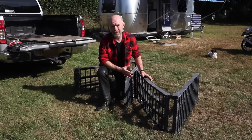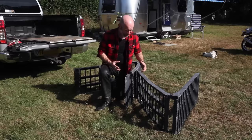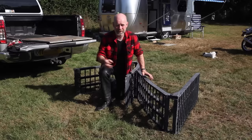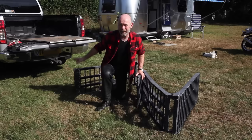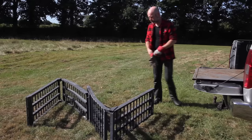Next up, I'd like to talk about the ramps. These are from theramppeople.co.uk — I paid full price for them and have no connection with that company other than being a very satisfied customer; great customer service and super product. They're foldable because obviously you need to be able to carry them so you can use them at the other end. I have two — one for the bike, one for me to walk up next to the bike. I tried with one ramp to start with and it was just way too dangerous to use steps next to it. The main thing when using ramps is to make sure they don't slide. I've got little bolts in the end that Rich put in, that just fall into holes in the plate. If you're not using a plate, you need to make sure they're ratcheted down so tight they won't slide. Sliding is your enemy.